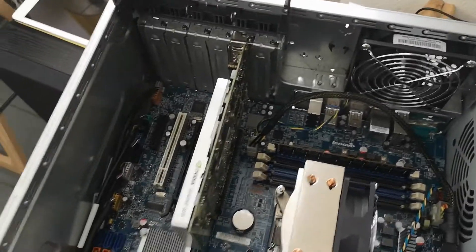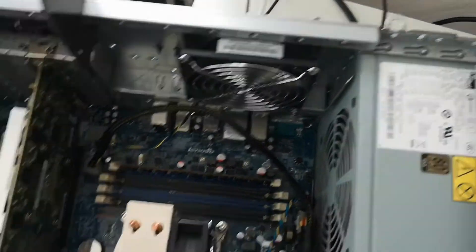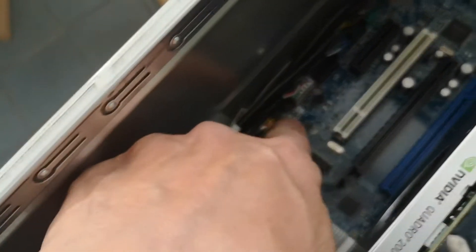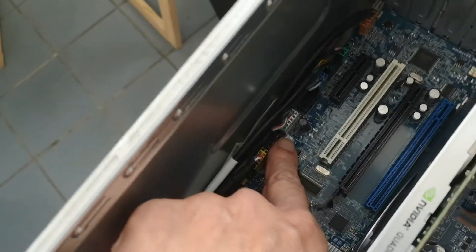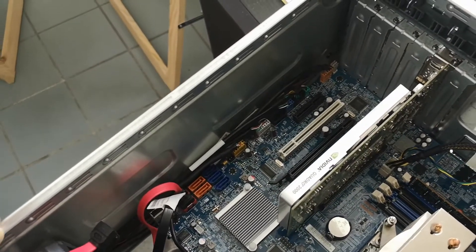Then what I have to do is remove the power connector for safety — also because there's some standby power on the main board — and take out the USB stick with the BIOS on it. Then I'm going to move the jumper back to positions 1 and 2, the CMOS reset jumper. Don't be afraid to flash the BIOS of your dead computer using a USB stick and the CMOS reset jumper. The flashing was successful — the machine works again.